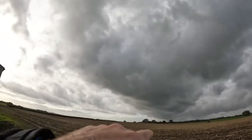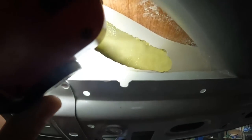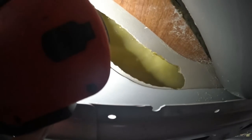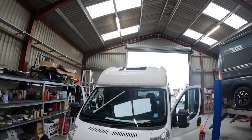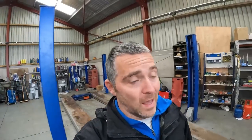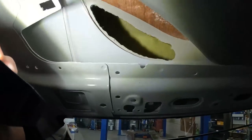That cloud doesn't look good — I'd better get it inside the workshop. It's not going to help making it more wet. I've cut some exploratory holes and managed to get all the water out. The water level was actually above the hole, and there's the outer fiberglass roof. I've sealed the front skylight now — I think it was probably that false skylight causing it. That's been resealed, so I'll give it a water test tomorrow once the sealant has gone off.